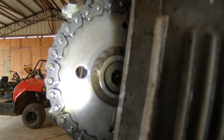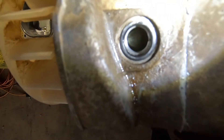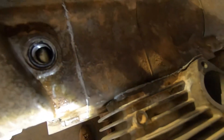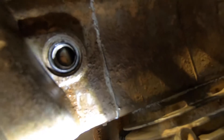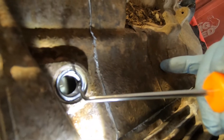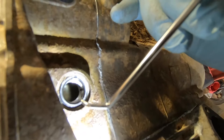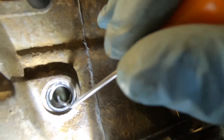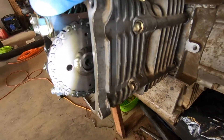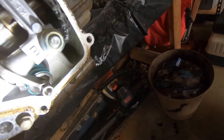Then you make sure your crank is in the right position. To line the crank up, you have a little line on your flywheel. If you look over here, you want to line it up with this little line right here — it'll be in the threads where your cap sits. So you line that up, line your line up here, make sure you're good over here, and you're ready to go reassemble. You won't have any problem striking one of your valves with your piston.